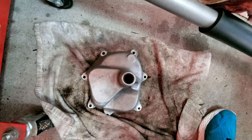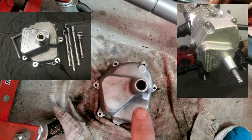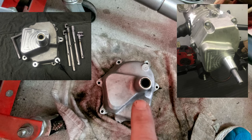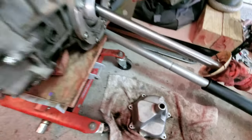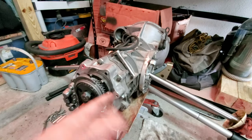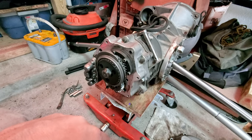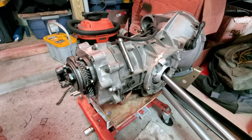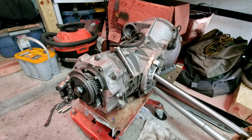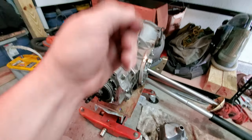So when you're looking at the end cone, you kind of see how the input shaft where the hockey stick comes through is sitting there. Well, it's actually going to move down about an inch farther to allow for a better alignment with your shift rod. And anything that can help out with the install or make it a better install, I want to go ahead and do things better if I can. So that kit costs about $650, and it's about a three, four week wait still on that coming in from Dave Foltz up there in Ontario, Canada. So it's time to get to work, guys. I got some side plates to remove. I'll come back in a little bit and we'll talk about exactly what's going on with that and what is changing. Sound good? See you in a minute.